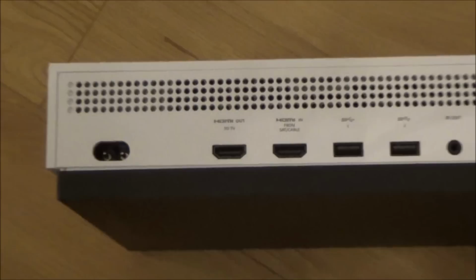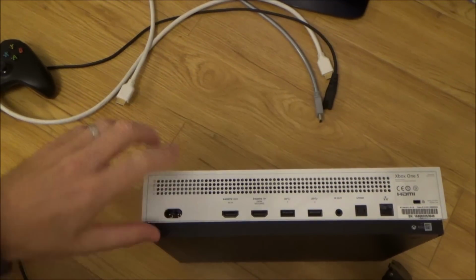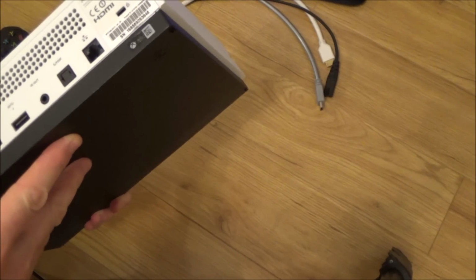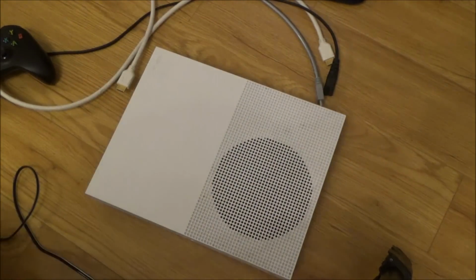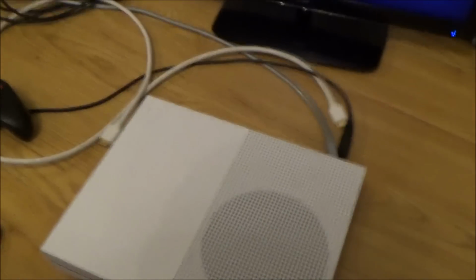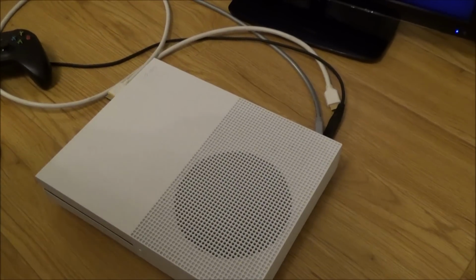I mean, obviously I could be completely wrong, and it might be something to do with where it meets the circuit board on the inside, but I don't believe that port itself is faulty, because the contacts look okay, unless of course they're dirty, which is possible. But I can always try that. I can get something with a bit of alcohol on it and try to remove it, just in case there is a tarnish.